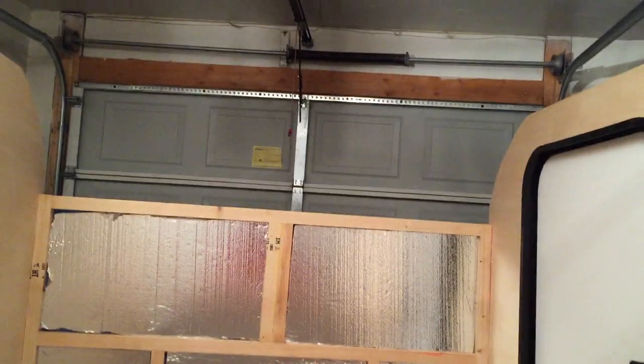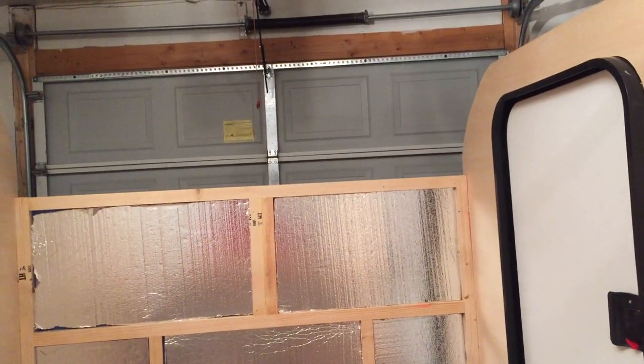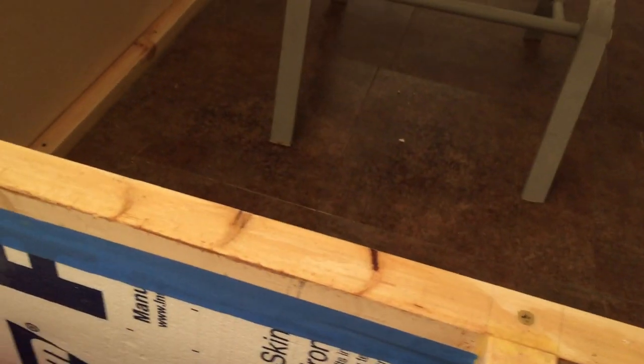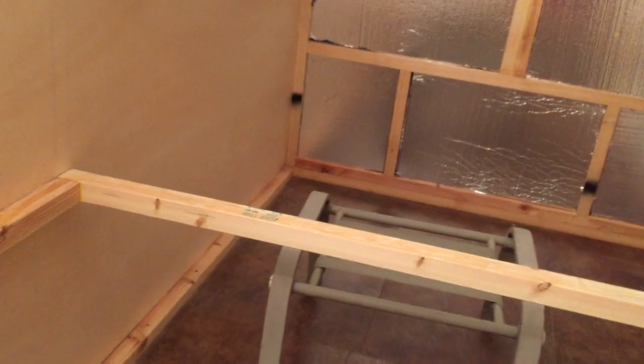After I put the rest of the cross-members on the roof, I'll get the luan on the front and wrap it around — it's going to take about two sheets to go from the front to this point. There's a double-thick cross-member here to allow for the hatch, which will be weight-bearing. Then I'm going to do one solid sheet from the back all the way to the front to equally distribute the weight. Half of it will be the counter for the galley, and I'll build a divider wall, with the other side being the gear loft entertainment center.